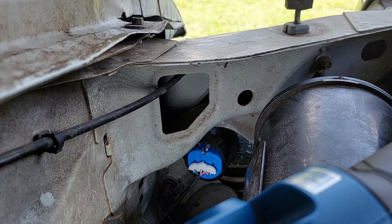So one thing that is pretty neat, at least according to AUXITO, I mean, I'll be testing tonight once the sun goes down, and I will do a comparison compared to my old ones about the beam spread and everything. But according to them, you don't have to worry about the orientation of the LED. So one thing that happens when you do a conversion to LED, because of how the headlight bucket reflectors are shaped, is you have to have the emitters generally pointing at 9 o'clock and 3 o'clock. Otherwise, your beam form, or the actual shape of the light being thrown by the bulb, is wrong. And there'll be a bunch of glare, and you'll blind other drivers, and they're going to be really mad at you. And it's just not good. So generally 9 and 3, according to AUXITO, and again, I will be skeptical of this until I can look at it and test it myself.